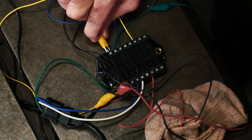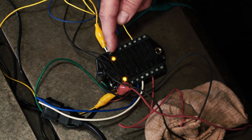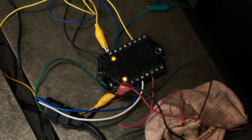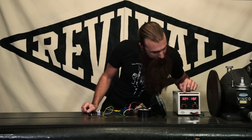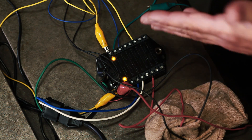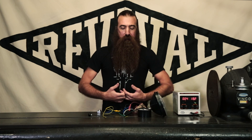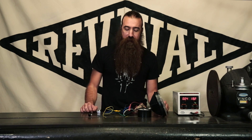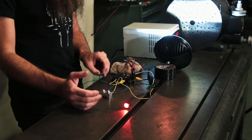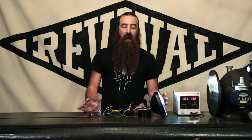So we'll turn it on. We've got this janky little alligator clip that we're going to connect to the lock input. When we do that you'll see that the lights will race around the outside and then stop with the lock input lit and the auxiliary output lit. Right now we are consuming 0.04 amps — that's pretty typical for this on condition. That's just the steady state draw that the M-Unit has. We can turn a couple things on; we'll start with the headlight. We've got a tail light, a headlight, and we've even got a brake light. So the M-Unit is in a normal operating condition.